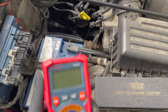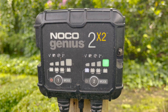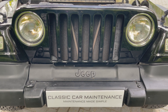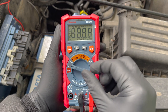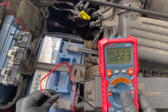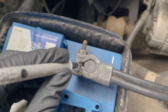To test a car battery with a multimeter, you only need one thing: a multimeter with DC Volt settings. If your battery was hooked up to a charger, first disconnect it and turn on the headlights for a minute to remove any surface charge that might give a wrong impression of the battery's health. Then take your multimeter and turn the dial to the DC Volt setting. If you have multiple volt settings, choose the one that's closest above 15 volts. Connect the red lead to the positive battery terminal and the black lead to the negative battery terminal.